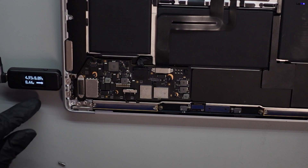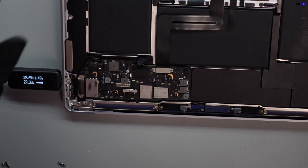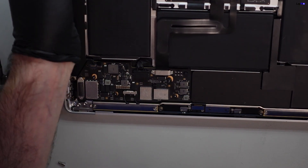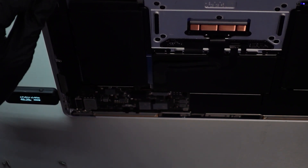Let's plug it in — we're getting our 5 volts and it went right to 20 volts. We're getting about over an amp, getting closer to 2 amps. Looks pretty good. Wait — we're not getting anything on the screen. All right, I had to disconnect that screen and I'm using another screen right next to it, but it's connected and we're getting an image. So it looks like they also have a bad screen.